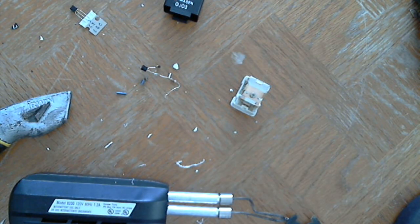It was a distributed 4-cylinder with one coil going through a distributor, had its own little igniter, and the tachometer worked off of a signal that the igniter was providing, which was the coil negative. So every time the coil would collapse, basically, I'm not going to go into the full wiring diagram, that signal was sent to the tachometer. When a coil collapses, that's when it's providing a spark. So it would send that pulse signal to the tachometer, and the tachometer would work that way.